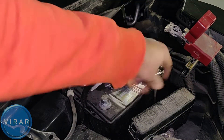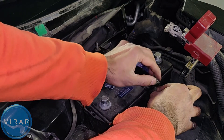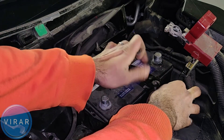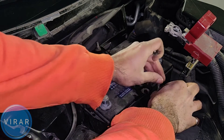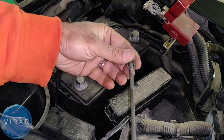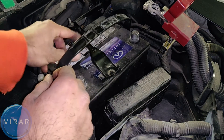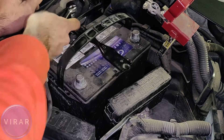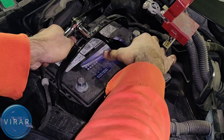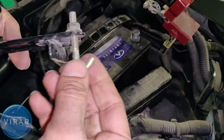Now let's loosen up that one nut and get it out all the way. Once that nut is off, we should be able to lift up the retaining plate, slide it out of the way, and get that other big rod out of the hook. To make sure we don't lose it, put the nut back on the rod. Now we need to loosen the other nut for the retaining plate — we don't have to get it all the way off, just loosen it a few turns, and that gives us enough play. The rod has a hook end on its end, and once I get the battery out I'll show you exactly what that hook end goes in.